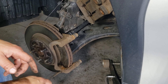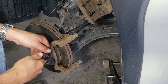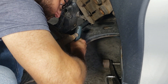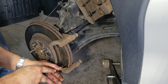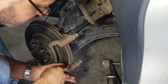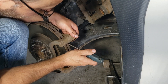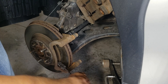I'm just gonna scrape it lightly with my screwdriver to make sure the grooves are nice and clean — I'll try not to damage the rotor too much, just removing any bigger stuff. If these clips don't sit in deep enough, the brake pads could stick. You want to make sure they can slide real well. I'm going to hit that with a little wire brush to clean it up.